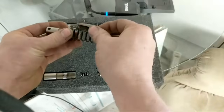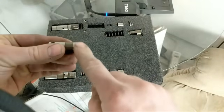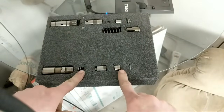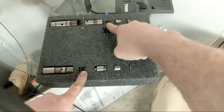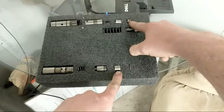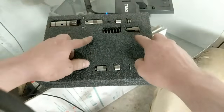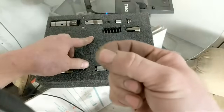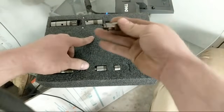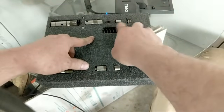Normally when you see them, they look like this with that spring compressed, so you can see how that assembly goes in. What I wasn't sure of before was what's inside these — but now that I've got it apart and compare the two, you can see identical pieces: this spring and this spring do the same function, this piece and this piece do the same function, and these two are the same function. Where it gets different is that it's obviously much smaller, like a miniature lifter, and then the retaining clip — this one has a little clip that holds that piece in, versus the DoD lifter which has this crazy spring-loaded contraption.